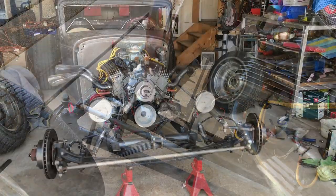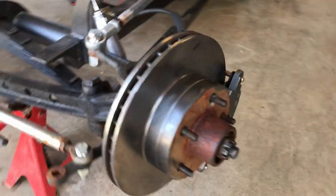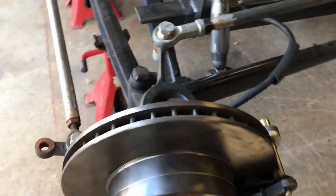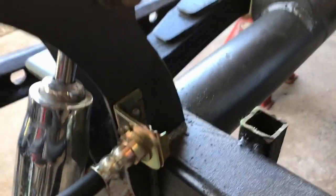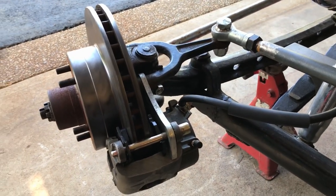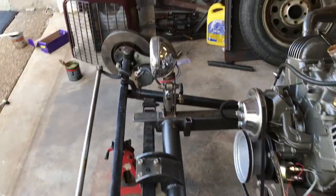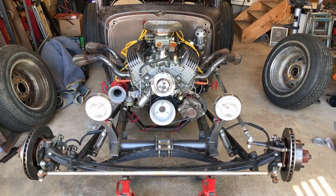Front calipers now installed. Cleaned up the discs because they've been sitting for five years doing nothing — they're brand new, they've just got surface rust on them. I had all the parts I needed: got the pins, banjo bolts, washers, welded a little bracket onto the side here. So the hard line will go from here, probably down behind here and run along out of sight, way along there up to the master. I'm going to leave the wheels off while I bleed — it makes life easier if there are any leaks I need to attend to. Next is basically just running the brake lines.